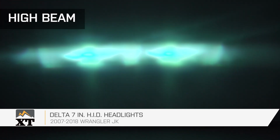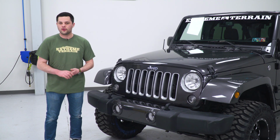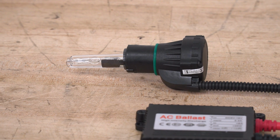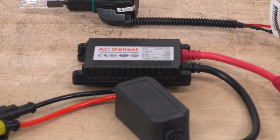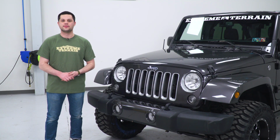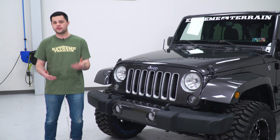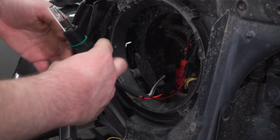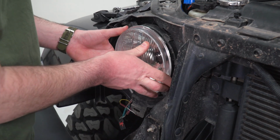The hotspot brightness is clearly a step up from those halogens. HID bulbs are also really easy to replace, but they are more expensive when they do eventually go. HIDs do come with a ballast box since starting the light takes a lot of energy. The ballast is also going to maintain the correct lowered voltage once started. That can add a little bit to the install just because you are dealing with a little bit of extra wiring when you go to an HID.